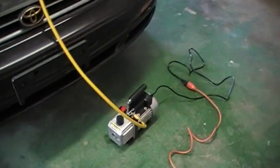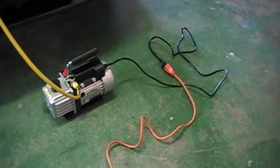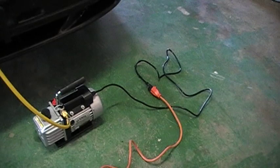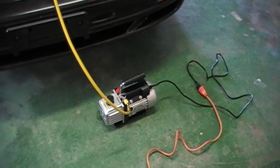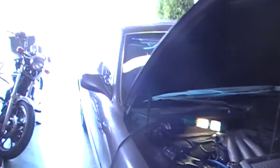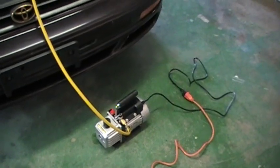A few safety notes regarding these vacuum pumps: this style generates a lot of heat. You want to make sure you use a grounded extension cord, and don't alter any of the power cords. Keep all this equipment clear of flammables, and always work in an open garage or open area with ventilation. Always watch for fire hazards.